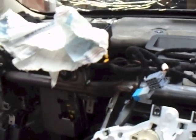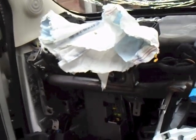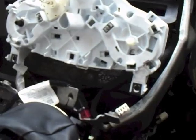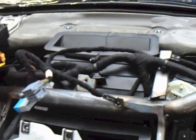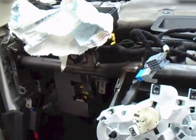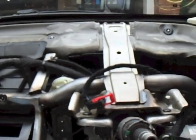There's the passenger airbag — that's just held on by, I think, one bolt, plugged into the airbag system there. That's a two-minute job to change. Obviously you change that first, then put the new dash in. Going back to the passenger airbag — there are actually two plugs on it, one either side. As you can see the bag's been cut. Take the bolt out, disconnect the two wires, take it out and put the new one in. The new passenger airbag is in — it's held in by one bolt, with an electrical connection each side, and it just pushes into two places down there.